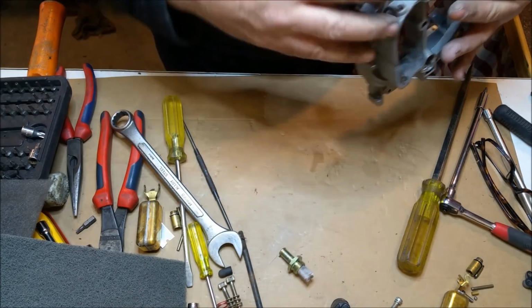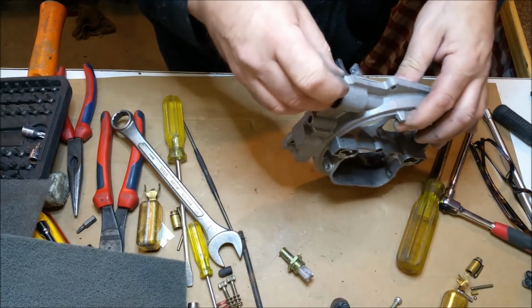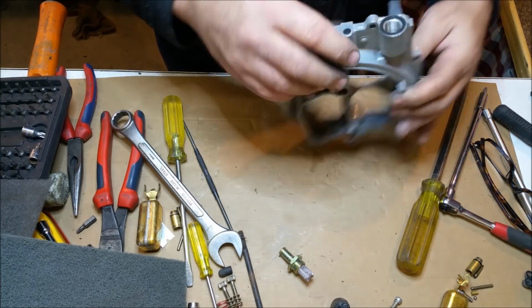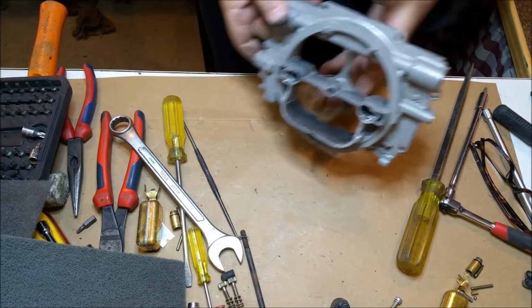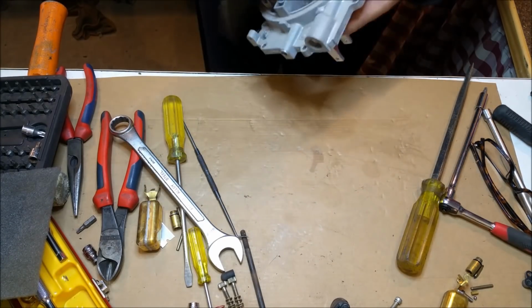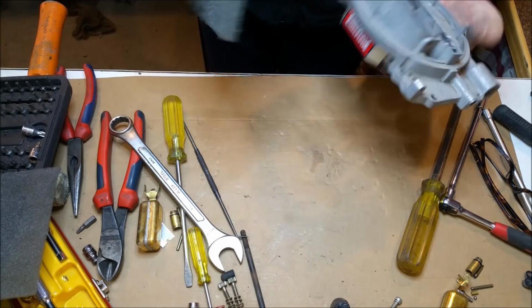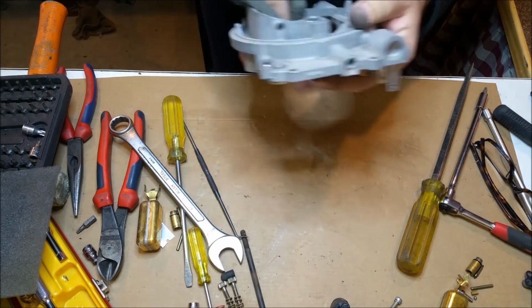Oh, there's a little gauze thing in there. And is that a gasket? Some sort of gasket? You know what? She's right. Let me just go blow this out. Let's give it a bit of a wipe in here first with a bit of Scotch-Brite, just to get rid of some of this corrosion pitting crap that's in there. And then I'll be back.